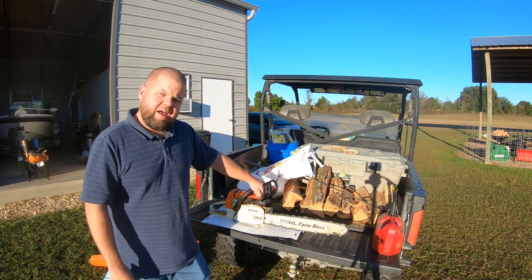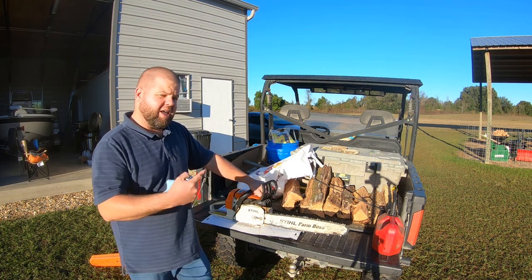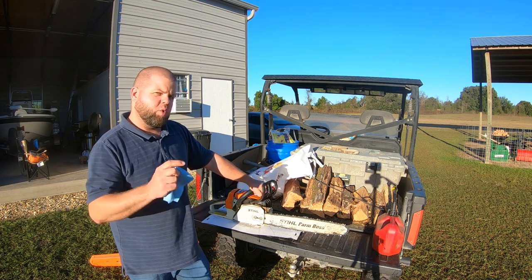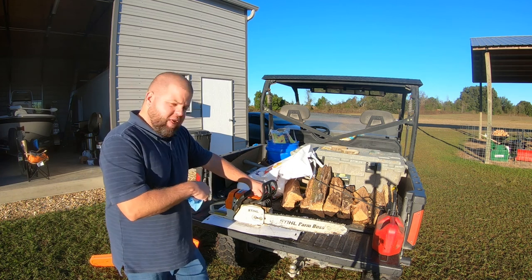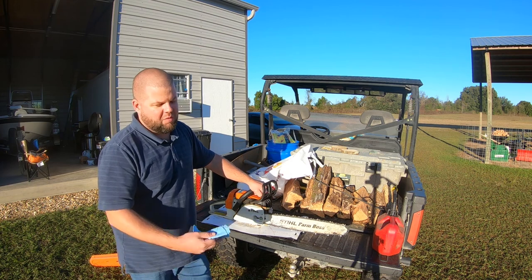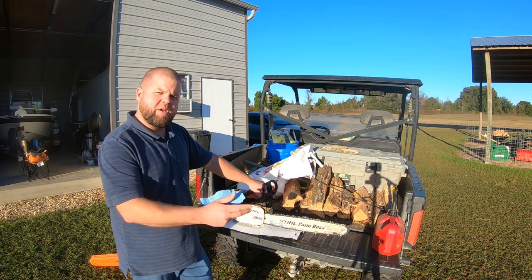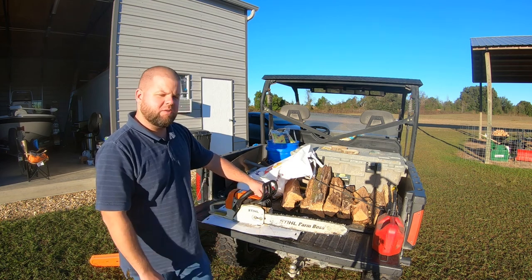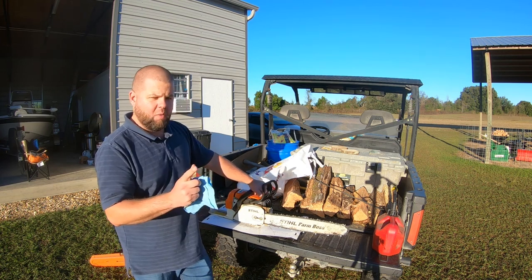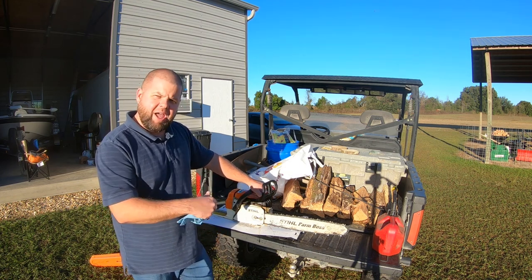So as far as the high speed adjustment RPMs, I was able to get it to hold at a steady 14,100. And I'm glad I did this because it was up well over 15,000 to begin with, so it wasn't quite where it needed to be. So that's back down now to what the factory says is safe, although 14,000 sounds crazy high to me, but I guess that's just the way these little two-stroke single cylinders are. I'm getting the idle to hold between 2,800 RPMs and 3,000, which is fine. The chain's wanting to start kicking in at that speed, but not quite, just the way I want it. Throttle response seems a little better. No bogging yet, although it wasn't bad beforehand.